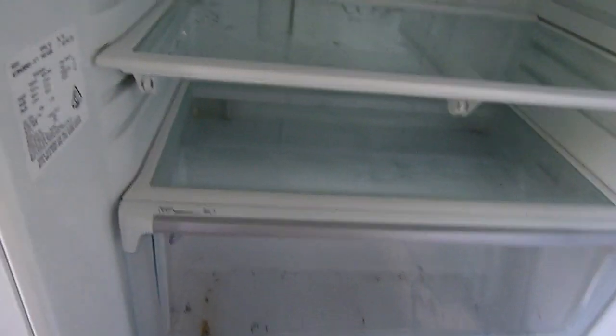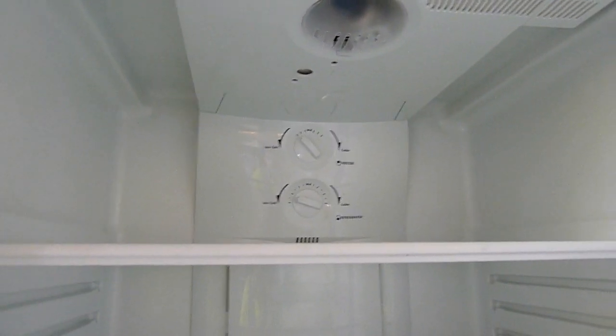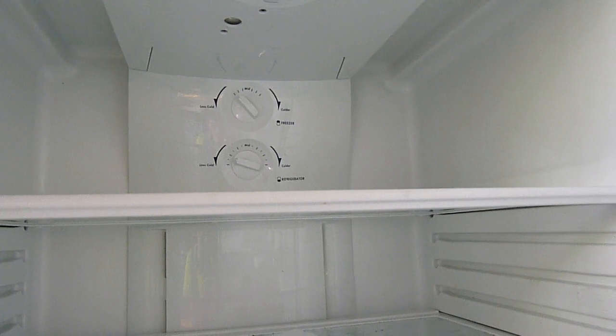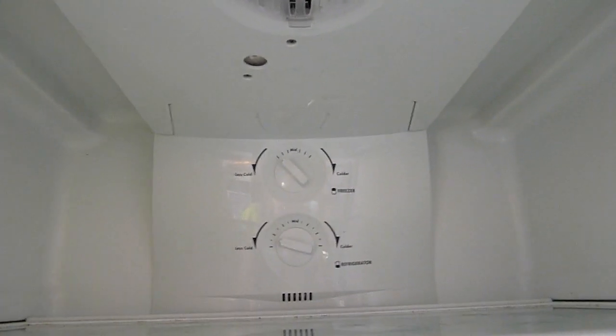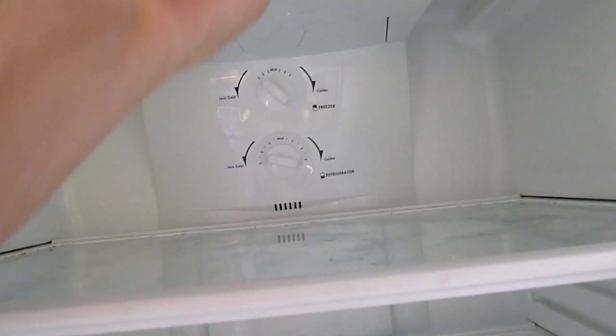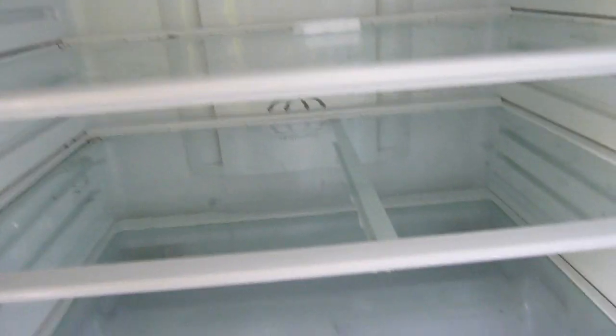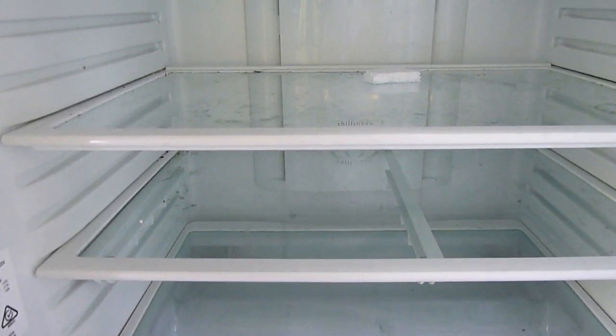Let me know what you think — it's just got me stumped because there are no obvious signs of burning, flashover, or anything to explain the smoke. It still works fine; I could plug it in now and it wouldn't do it. It'd just be once in a week or two or three, it might go bang again and stop. It didn't take out the circuit breaker or the RCD. If it was a defrost element going, it would have taken out the circuit breaker for sure. My mum has the big double-door version of this and I replaced the defrost element in it because it was taking out the safety switch RCD — that was a $70 part and about 30 minutes labour. Anyway, if you can help, great; if not, no big deal. Thanks for watching.